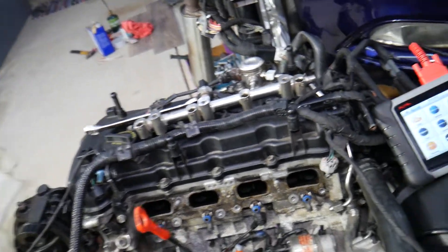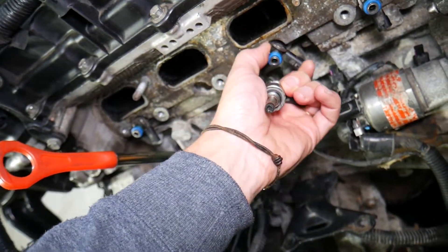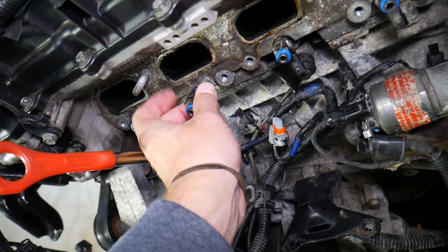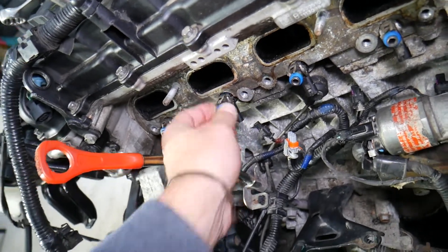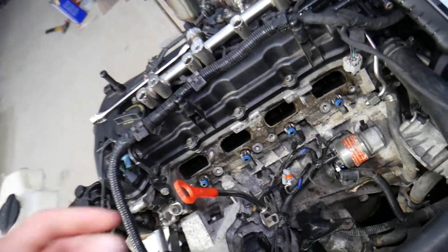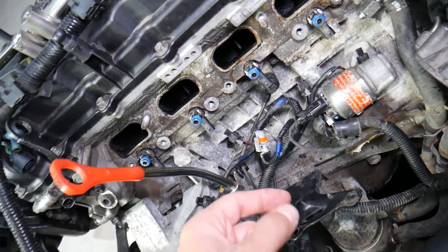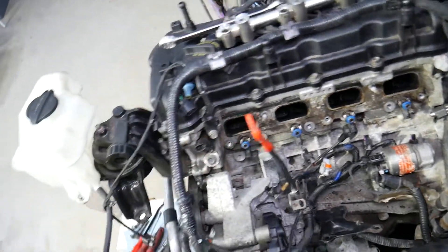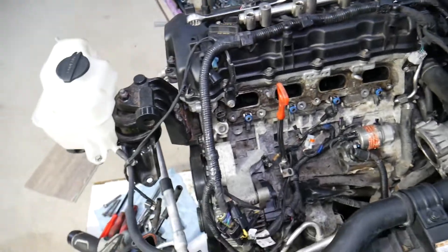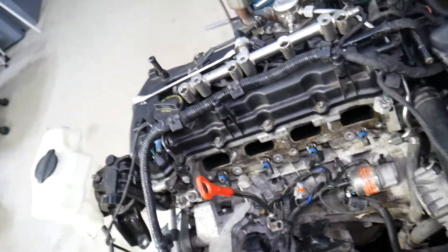What if the engine is getting more fuel than it should? It could be a leaking fuel injector. If your fuel injector is leaking, it can spray more fuel than needed, or when closed it will drip fuel into the cylinder, resulting in a rich fuel mixture. This is extremely dangerous — you can damage catalytic converters and oxygen sensors. Extra fuel can also get past the piston rings when the car is off, going into the oil pan and diluting your oil. The oil won't lubricate the engine properly and you may destroy your crankshaft bearings and cylinder head.